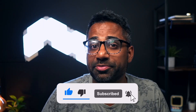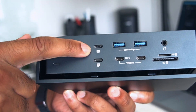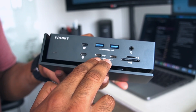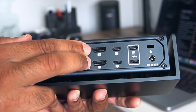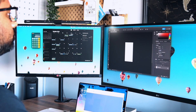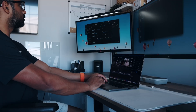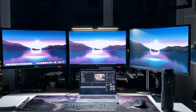Now the fun part — let's talk about those displays. We have four USB-C ports at 40 gigabits per second, two on the front and two on the back. These are all downstream ports, so any of them can power up to two displays at 6K 60Hz. The remaining two can be used for anything else that isn't a display. We also have two HDMI 2.0 ports, which run at 4K 60Hz. So that gives you a maximum of four monitors in crystal clear clarity. The best thing about this dock is that it is plug and play — no extra drivers or adapters needed. It is now my current workstation powerhouse, and I don't see myself replacing it anytime soon.